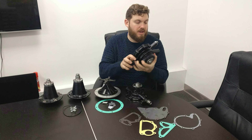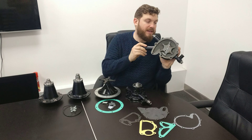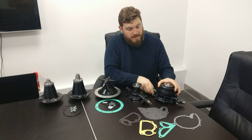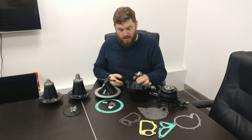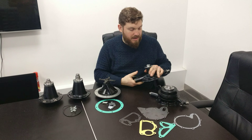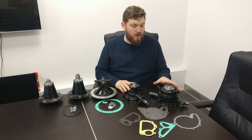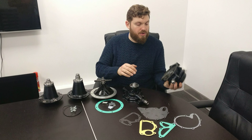That's the same for a later Mark VI — I think GT onwards — but you've always got to check. That's how we differentiate between what type of pump you've got: whether you've got the removable pulley type or the flange pressed on after the pulley. If you've got an S1, it looks like this.